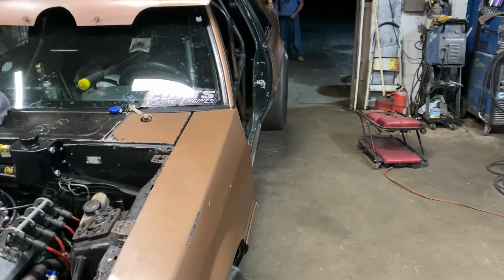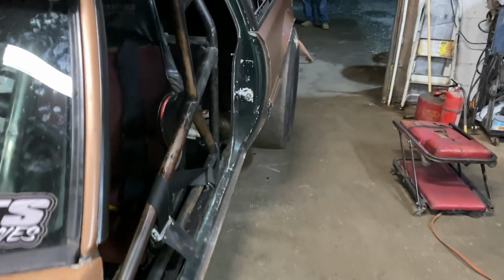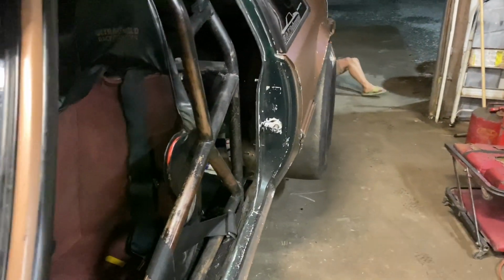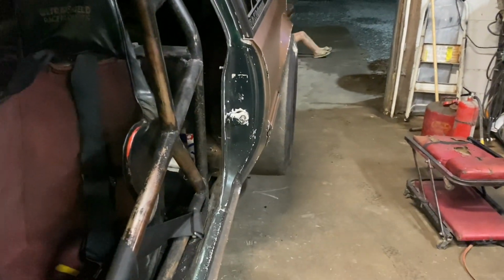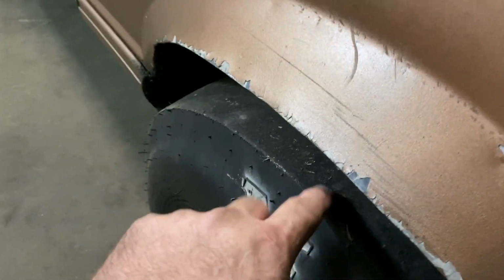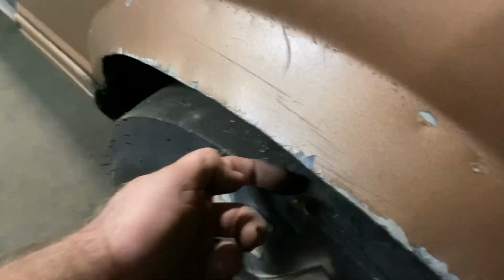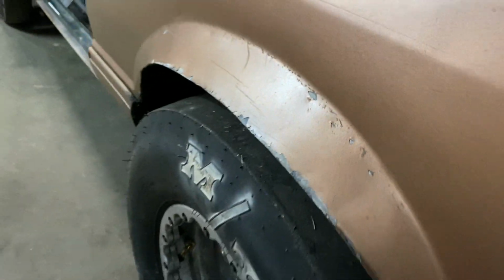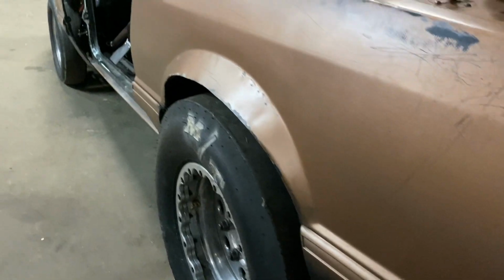And you know, this rear end is factory width. The wheels are 6-inch back spacing with a 1/4 inch or 3/16 spacer. And so the wheels stick out quite a bit, but they're flush with my fender now, which I have rolled out, obviously, and modified heavily. If this car squatted, it wouldn't work because this would hit this, but it doesn't squat. It separates mostly, and it doesn't do a lot of separating. So this side over here does the same thing.